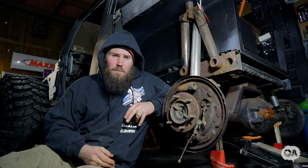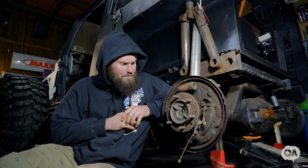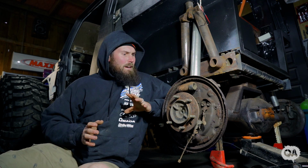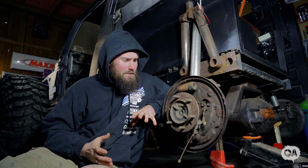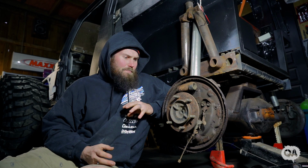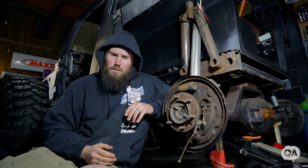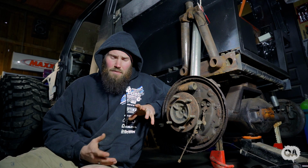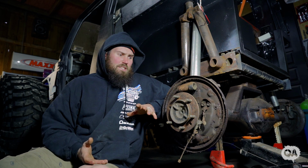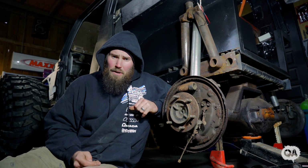Righto, so you're probably wondering by now what I'm doing. I know I mentioned I was going to do a disc brake conversion. Kind of what I'm doing. Basically went down to the auto parts store today and I got the rotors. And the rotors that I need are for a Mitsubishi Challenger or Mitsubishi Montero Sport, I think you guys call it in the US. I believe the parts are the same from 97 to 2004. The ones I got are off of 2001. It's the same part number all the way through.